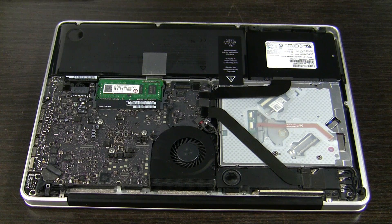I am ready to install the cover of my MacBook Pro. If you need to get rid of some dust now, it's a good moment to do it. You can use a canister with compressed air — just be careful not to damage any fan blades and keep your canister in the upright position.